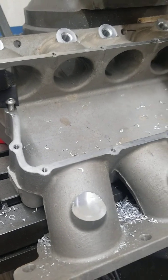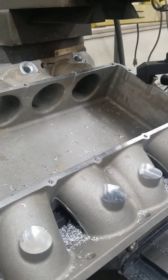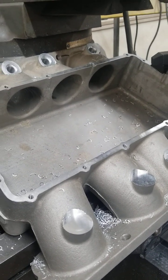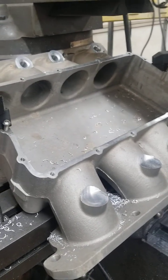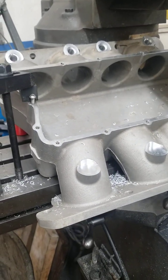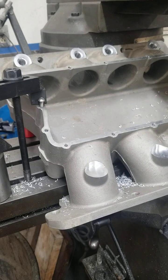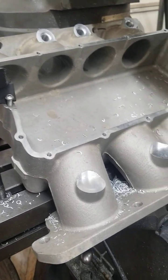We use a 530 end mill on this, and the outside diameter of the O-ring is somewhere around 570 to 580. So it compresses the O-ring and makes a nice tight snug fit whenever the injector is in the intake manifold.